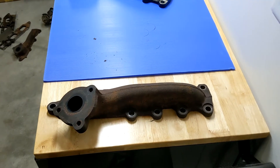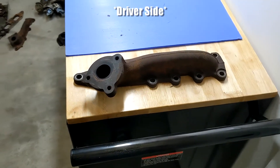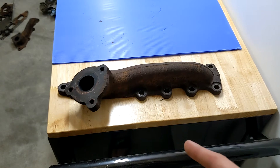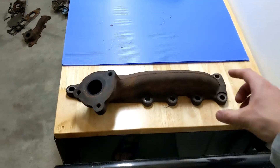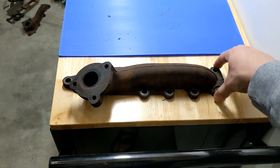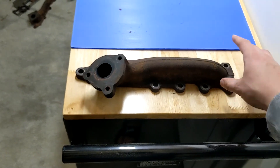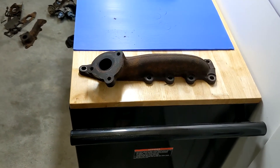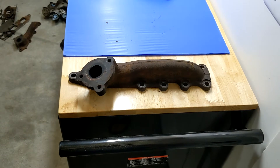What you're seeing in front of you is the OEM exhaust manifold — this happens to be my passenger side unit. On these F-150 EcoBoosts, these manifolds tend to warp, and that's the reason why I'm upgrading to those nicer looking units over there. To illustrate that warp, I'm just going to grab an edge here and wiggle it — right? So that implies it is not straight or not flat. Your block that these attach to is obviously straight, so that's where that leak comes from, and that's why it broke off that rear stud and causes that whistle and whirl.